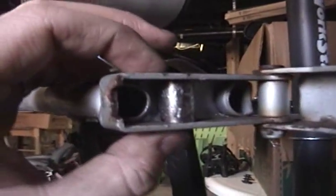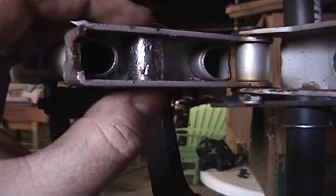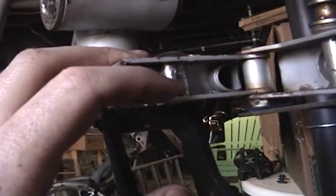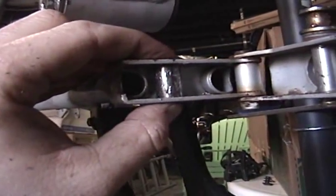I think this is actually going to be a very permanent repair. The reason why the holes on the top and the bottom got out of round is because the guide pin was only holding in this much sheet metal here — this thickness — which over time just got out of round. But with this tube here, assuming everything's properly greased, I don't think this can ever get out of round. So I have confidence in this repair.